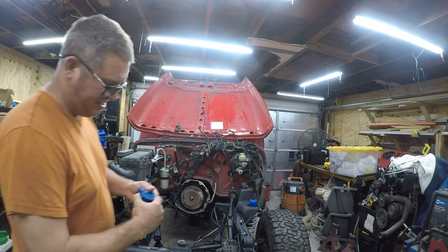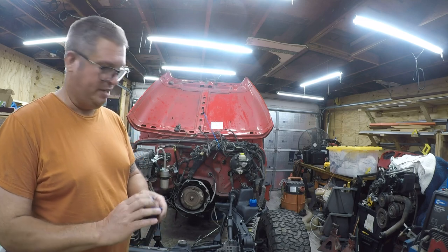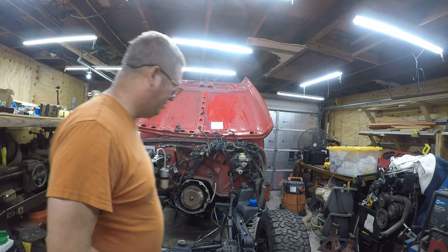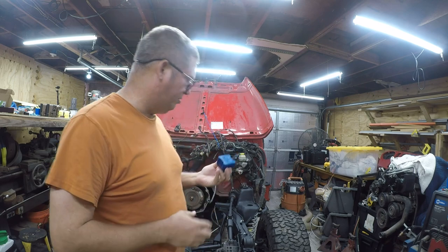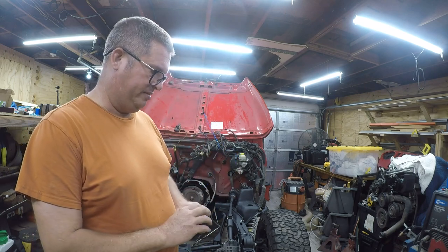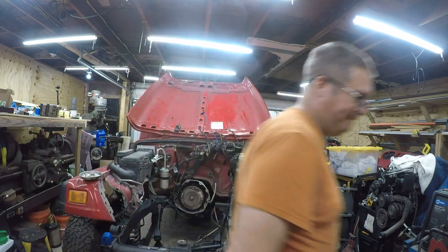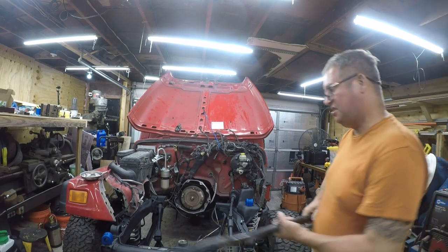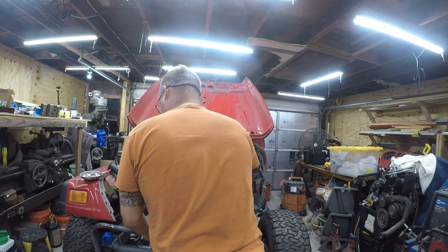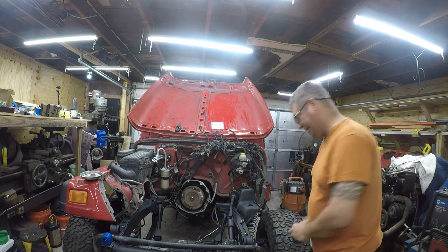One of the things that's nice is they are supposed to open, but these are actually really tough. So they don't open as nicely as I would like. The other ones would just fold over. These barely can open. So, gosh, I hope they're not polyurethane. I made a conscious decision not to use polyurethane bushings on my Jeep because they're very, very hard and they will just simply rattle the hell out of me, and I don't like that.